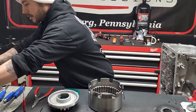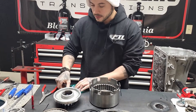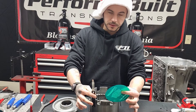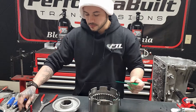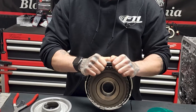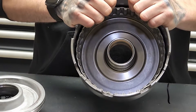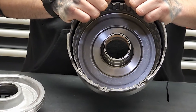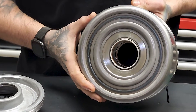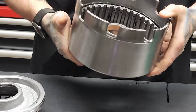For assembly, we're going to put the band aside. This piece is quite simple but takes a little finesse and skill because you are primarily going to be using the lip seal disc or lip seal knife — whatever your preference is. This is for beginners. We do our bushings — very, very important. You must be gentle with these bushings. Too fast is too bad; you'll never get the pump in or you'll clip the rings on the backside. Both these bushings and every bushing in your unit is probably the biggest mod you can do.